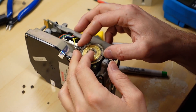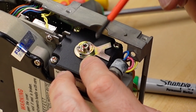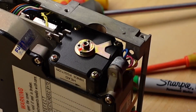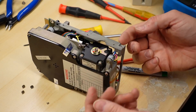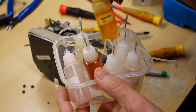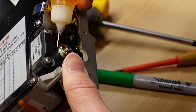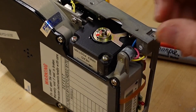All right, I got this wheel off. I did index it with a marker to know which way it goes on. That's the motor shaft in the center. I assume it's pressed on at the factory — maybe there's a hydraulic press that pushes it down. So I have my little assortment of things. This one here is bearing oil — that's what I'm going to drip in there. I'm going to try to get it underneath and turn this on its side and try to get the oil down into the bearing.